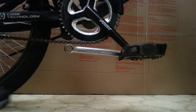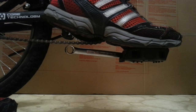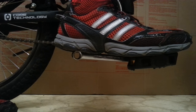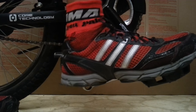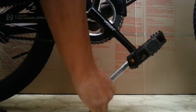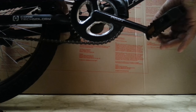Now what we're going to do is brace the bike by the handlebars. Put your foot on the pedal — the front part of your foot, under the ball of your foot actually — in a position as if you were going to ride the bike. Next, take your heel and step down with your heel on the wrench and kind of just step back into it. Apply your body weight with your heel to the wrench and still apply some weight to the pedal itself to the front part, and bear down with it and it should loosen. And as you can see, that's all it took.